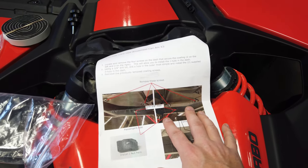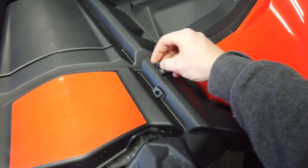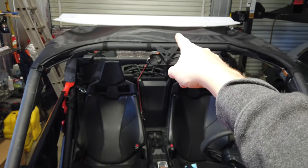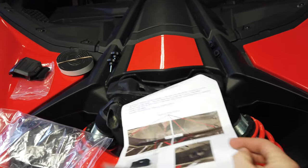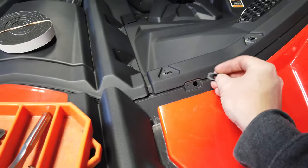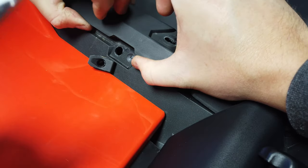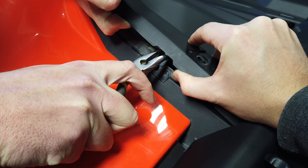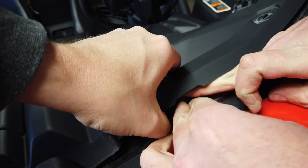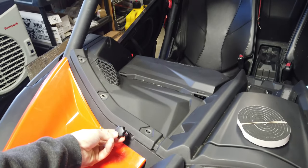We're getting started with the windshield. Looking at the instructions, we've got to pop these four bolts and then drill this with a 3/8 drill bit, slap these J-nuts right here, and then that'll be the clamps for the bottom portion of it. These are the clamps that go right here, and then we've got to put some foam tape on that once we pull the protective film off the windshield. Pretty straightforward, seems like a pretty easy install. Went ahead and drilled the 3/8 hole, now we just need to install these J-clips — try to lift up on this and slide it right in there. Nailed it, easy peasy!